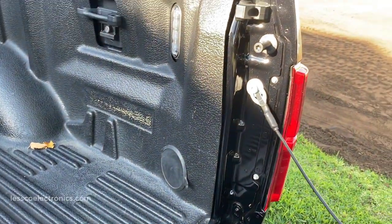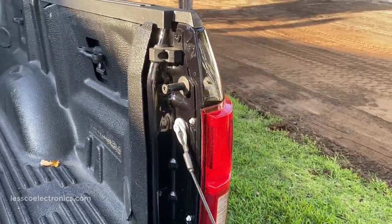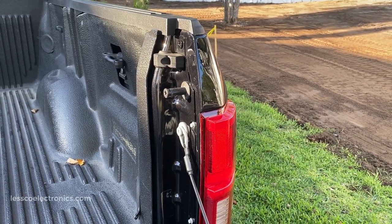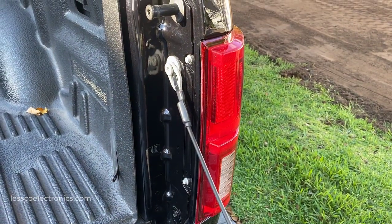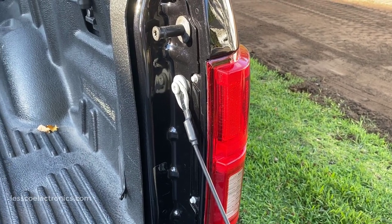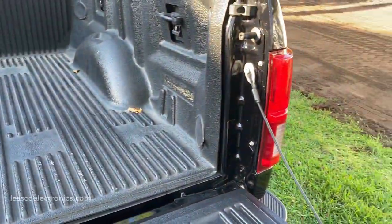I'm going to be hardwiring it into the corners to avoid CAN bus errors, because in my last video on my 2017 F-150 XLT Sport — I'll put a link to that — it gave me a CAN bus error. On this one I'm going to pull this light fixture out. I'm going to get my right turn, my brake, my parking lights, and my reverse from here, and I'm going to run a lead over to the other side to get the left turn signal.